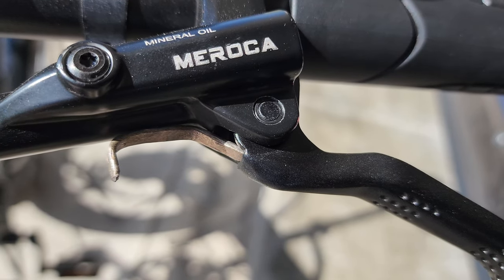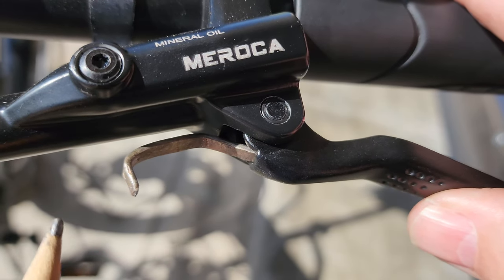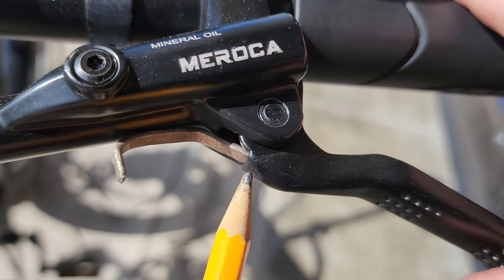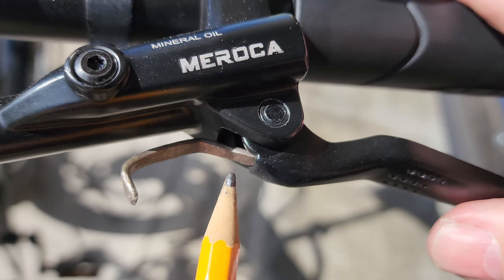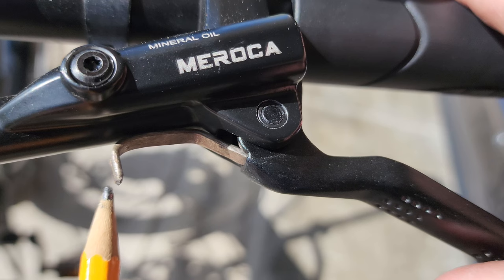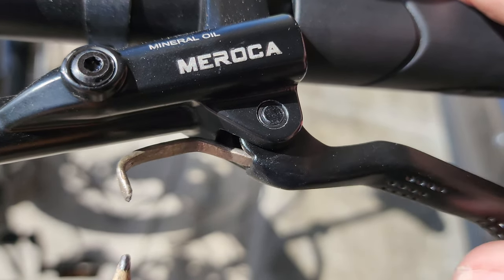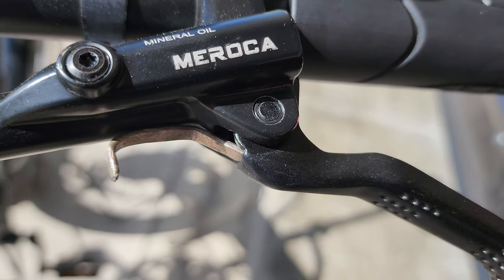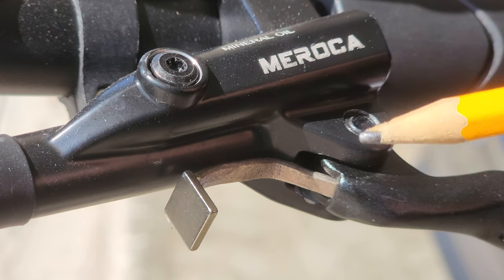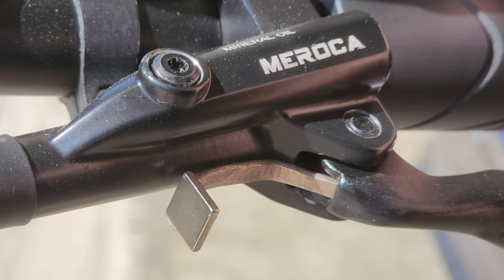It comes with 3M tape, and it'll stick right to your brake lever master cylinder assembly. Now, this little flat rod, I hammered it out from a piece of scrap stock that I had in my toolbox, and made the bends. It goes into the lever here around this pivot, which kind of holds it in place. It's got the bend to follow the contour of the master cylinder, and right here it has a flip out, and that flip out is where the magnet's going to go, and that gives you enough travel to trip the switch. This little magnet's going to go right on there, just like that. So this magnet will stick to that little bracket and move just like that.